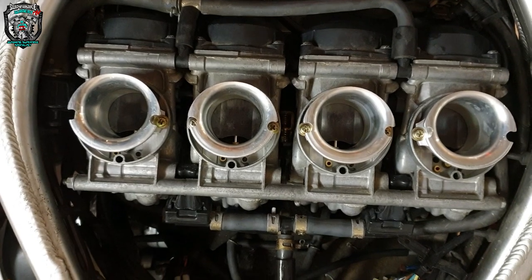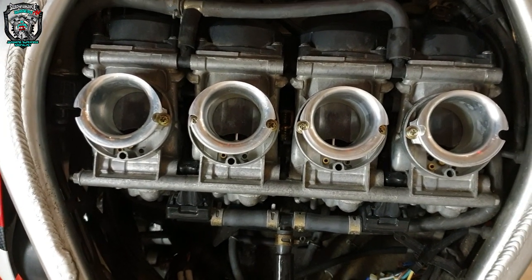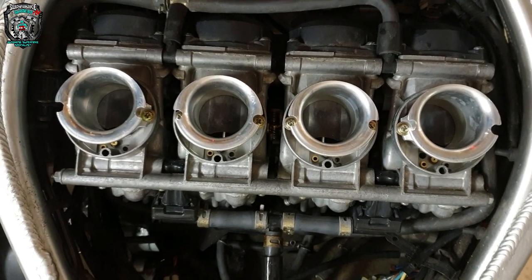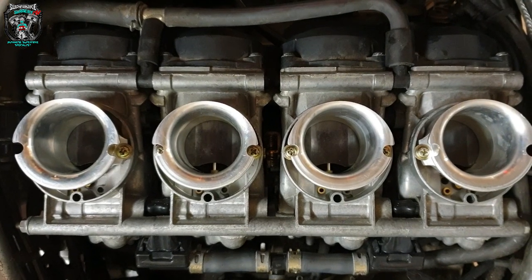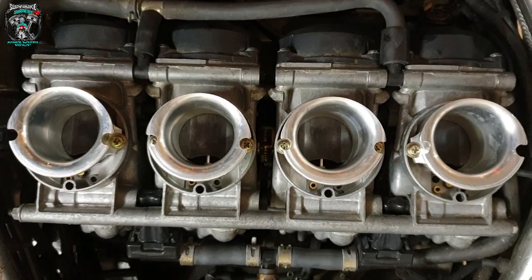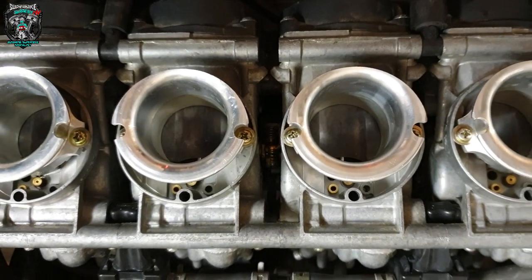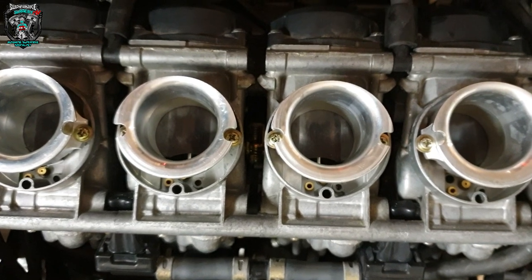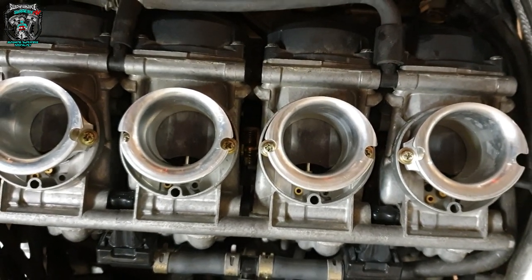Right, let's fill up the carbs. With a Yamaha, most of you know this already — when you turn the ignition on you get a few seconds of fuel pump prime, so you have to keep turning the ignition switch on and off to keep priming. Eventually you hear the fuel pump clicking and then the pump should stop — unless fuel is leaking out of somewhere, in which case it won't stop clicking. Still clicking... still clicking... okay.